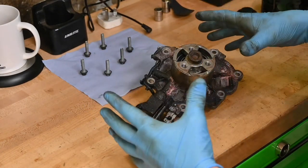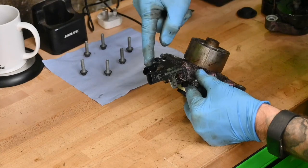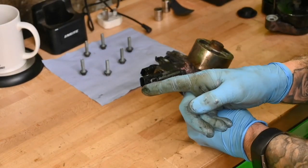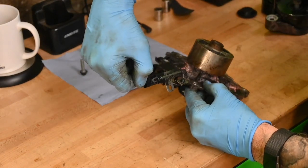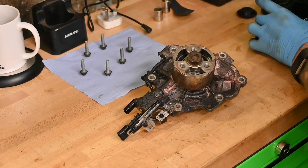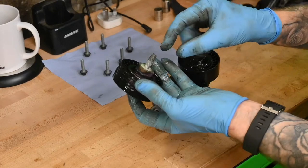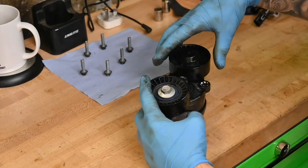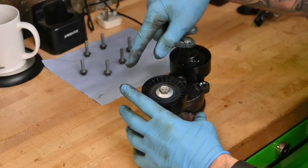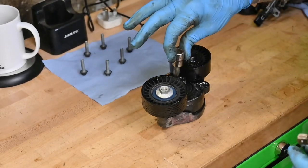Removing the pulley exposes the water pump itself, and you can gain access to the six 8mm bolts that hold it in place. Don't forget you have two connectors on the end — make sure you disconnect them first. There are a couple of safety catches on them that you have to pull outwards, then push down to unlock the tab to pull it off — same for both. Before cracking off the bolts, I advise taking off the idler and tensioner. The idler actually just screws into the body of the tensioner.